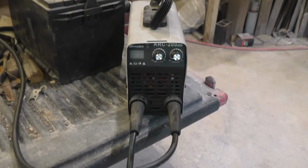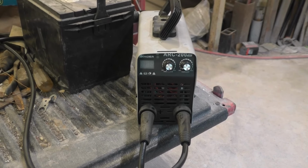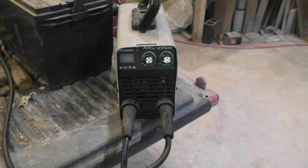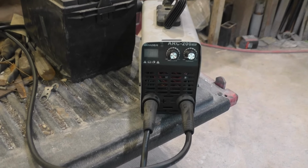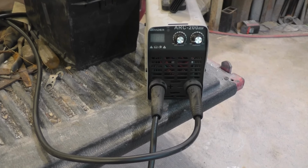When I load it down in my tank and set my current to 20 amps, it's putting about 5.5 to 6 volts DC, which makes perfect sense. It's going to pull that 70 volts way down to get that 20 amps or so.